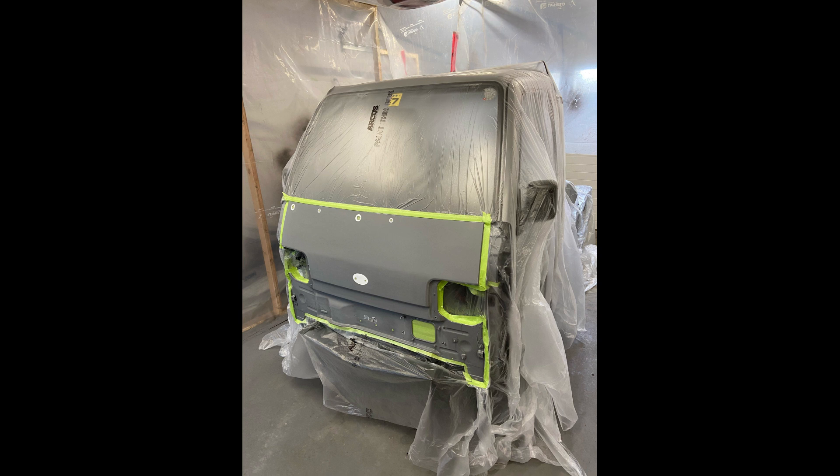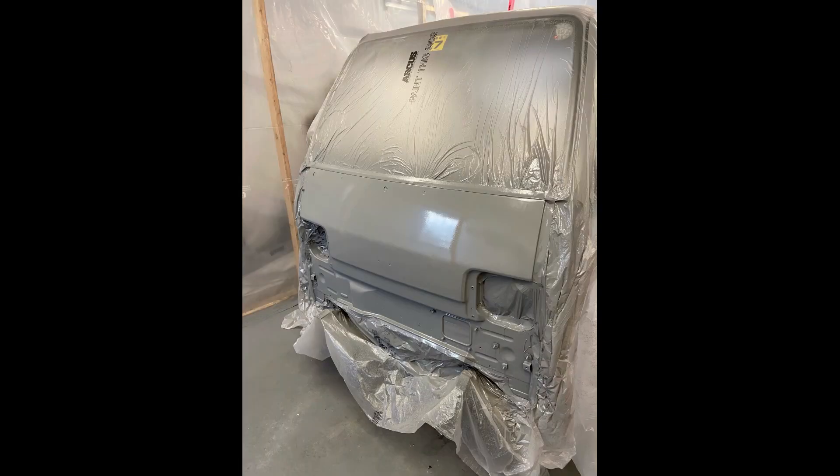Once those were done, the next step — because I did some welding on the cab and welded some bolts from the inside — it wrecked the paint. And actually the paint job I did wasn't that great anyway. So I sanded everything down, masked it, and in my little makeshift spray booth I painted the front of the cab again, so that was all nice and perfect.